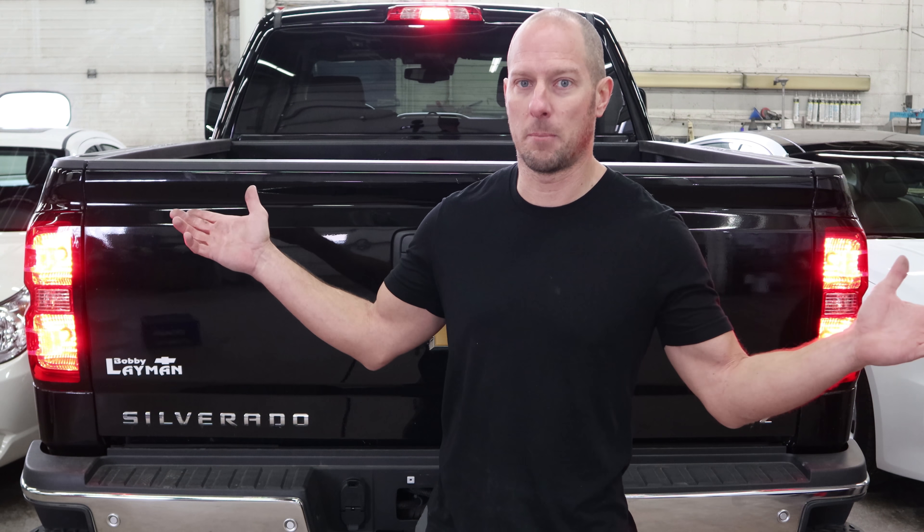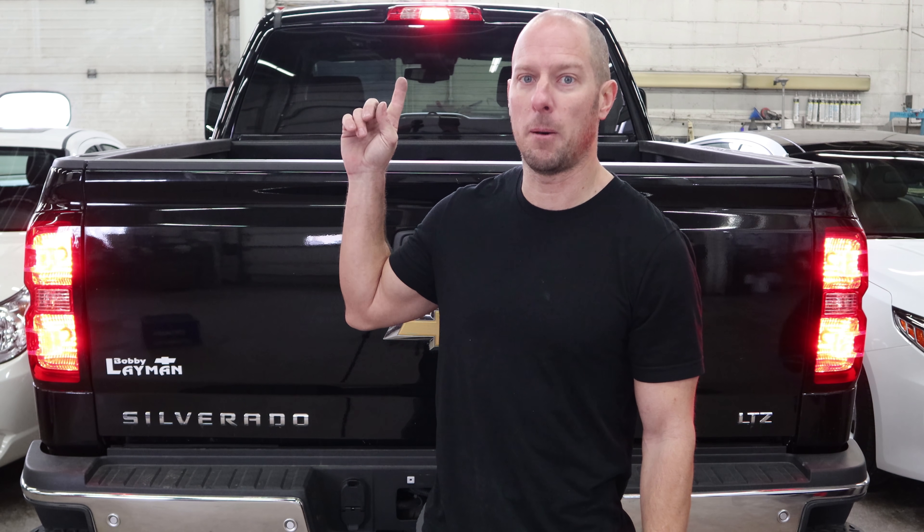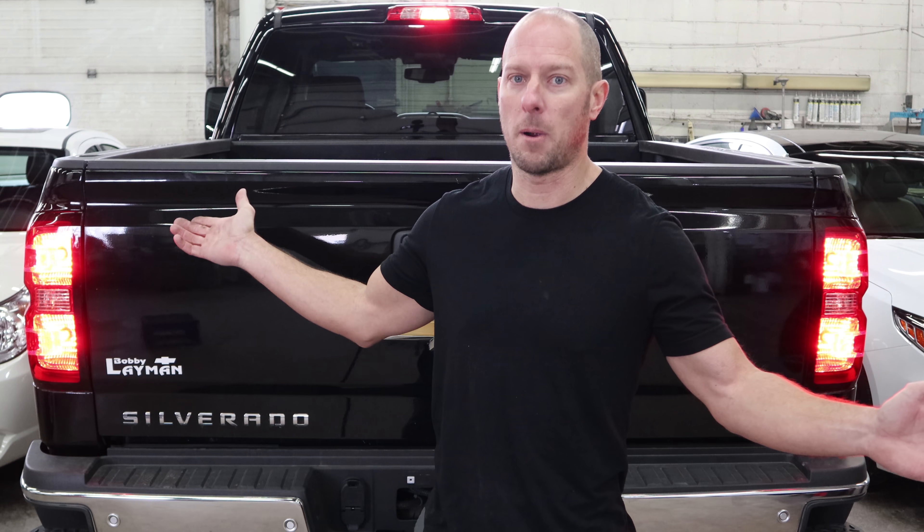Since we're answering questions today, on to the next one: what was the parasitic draw? It was just the brake lights. The brake light switch needs to be recalibrated, so the brake lights were staying on. I didn't know it at the time because there was no bed. As soon as I plugged them in and turned the key on, the brake lights were on — it was pretty obvious. The third brake light bulb happened to be burned out, so it was enough to keep the relays on and keep the BCM and ECM from going to sleep. On top of that, the truck also thinks you're getting in it to start it and keeps cycling the glow plugs, which takes a lot of voltage and kills the battery pretty quick. It's just a matter of recalibrating the brake pedal and our problem is solved.